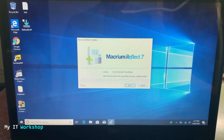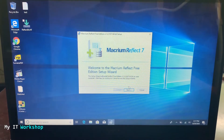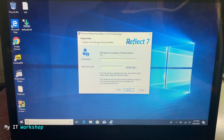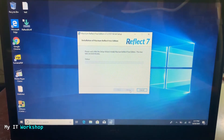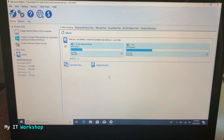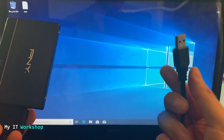After downloading it will automatically ask if you want to run or install it — say yes. Installation doesn't take much time. We're now in Macrium Reflect version 7. Agree to the license, select the Home version, uncheck notifications if you prefer, and create a desktop icon. The installation takes about 30 seconds and then it opens by itself. As you can see, it's already detecting our C drive partition. I'll close it now and connect the new SSD.